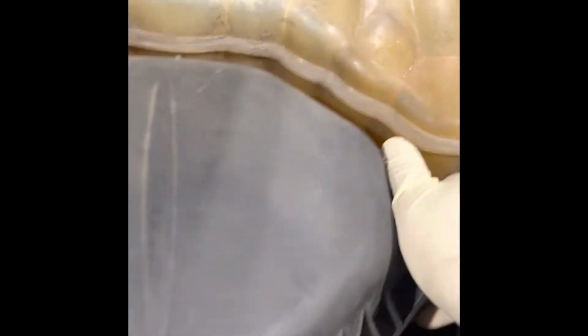I'm gonna start by disconnecting the hose here. It can come out easy. You can pry it. In my case, I just yank on it. So we're gonna remove the 8mm holding the box. I see one here. I think yeah, only one here, and then pull up, and then we're gonna go into the throttle body side.